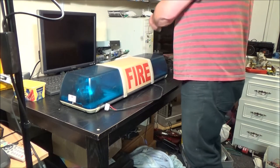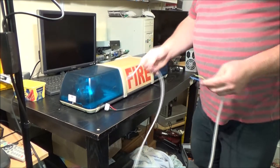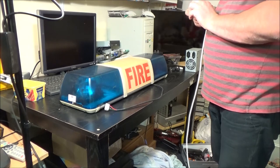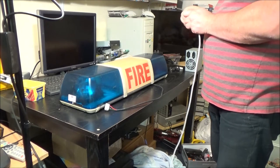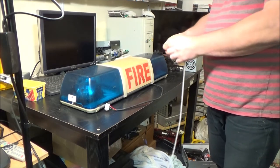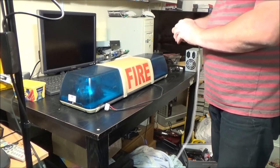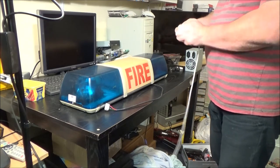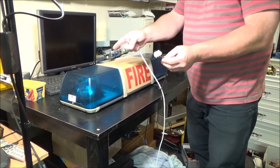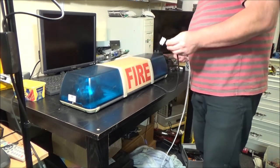in order to do that, I have got to reconnect this cable to that. I don't know how it came off, but it's come off. I've got to remember what wire does what. This is just an ordinary bit of 3-core flex. It's nothing special. I've got to remember what the wires do on the light bar itself. Because there's three. Because there's one for your blue lights, and then this centerpiece lights up as well.